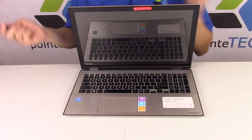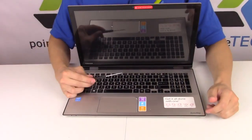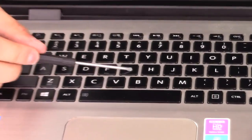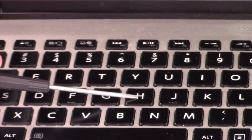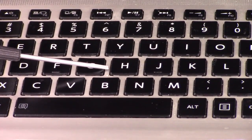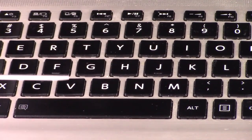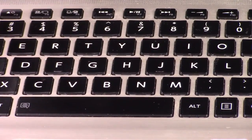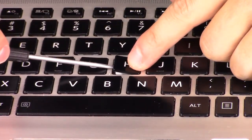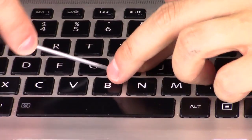In order to take one off to salvage it, you would take a small flat head screwdriver like this. We're going to try to get it underneath your key cap — that's the top part with the letter on it — but we're going to try to get it on top of the retainer clip underneath. The idea is to hold that down while we take the key off so we don't break it. You obviously can't see under there, so just feel it out and go nice and slow.